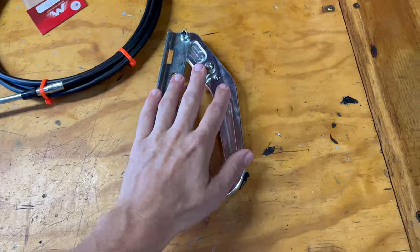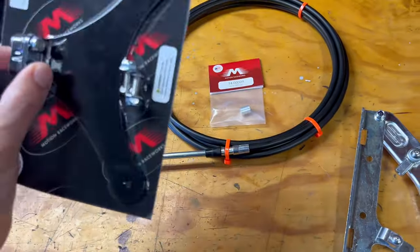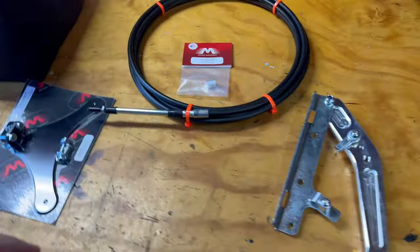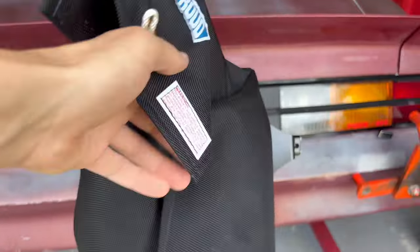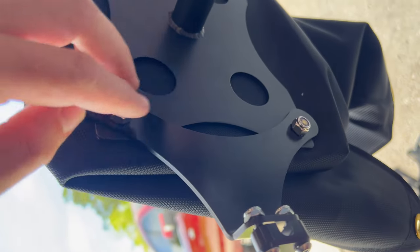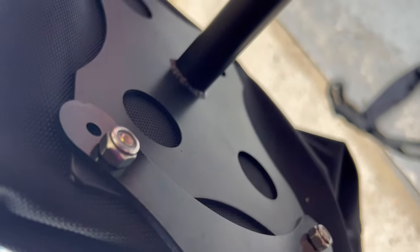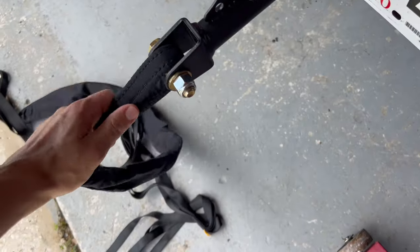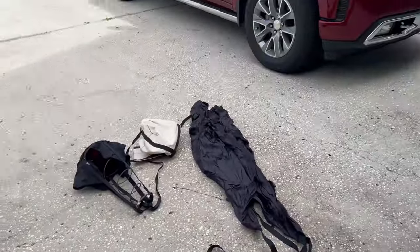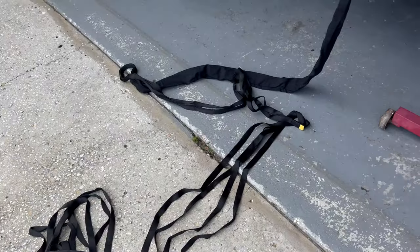Our parachute, cable, chute handle, billet end cap from Motion Raceworks, and the parachute cable holder all came in — you don't want a floppy cable. Thank you to Motion Raceworks for the fast shipping. We got the chute bag all mounted up to the chute mount and the cable on. I did have to redrill the two holes. The lock nut doesn't have much thread showing but it's fine since nothing structural attaches there — it just holds the bag. Now I need to pack the chute; this will be my first time.